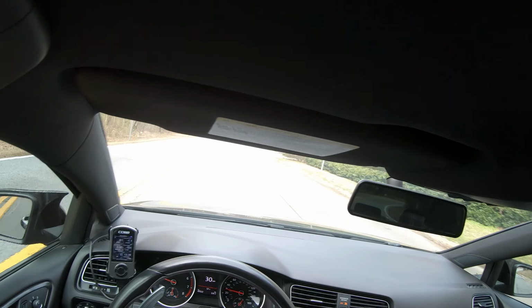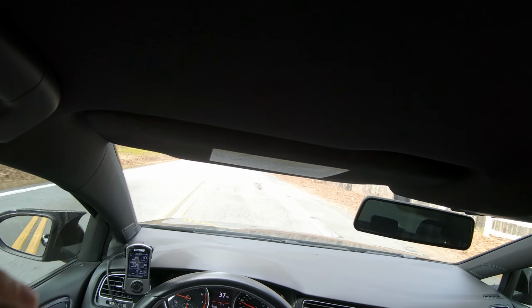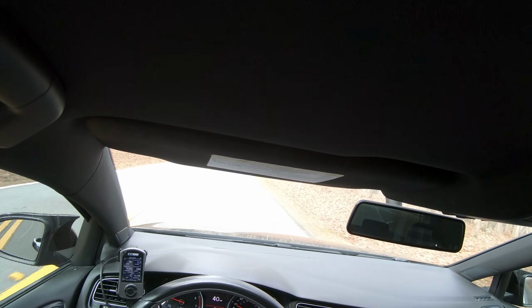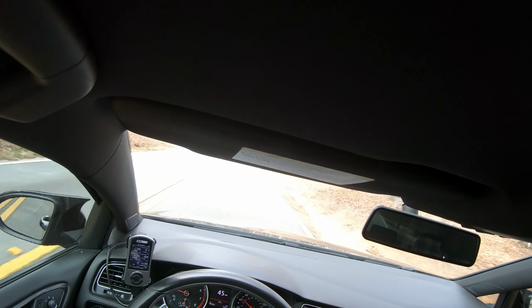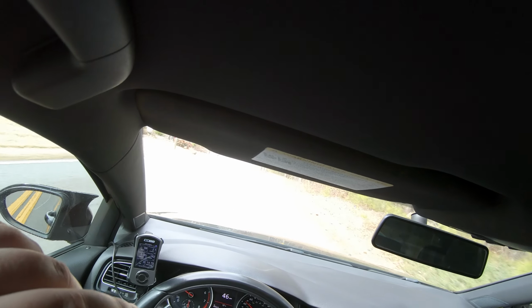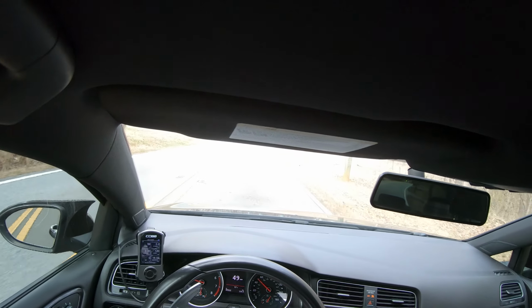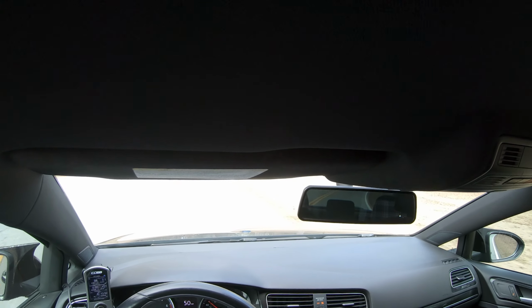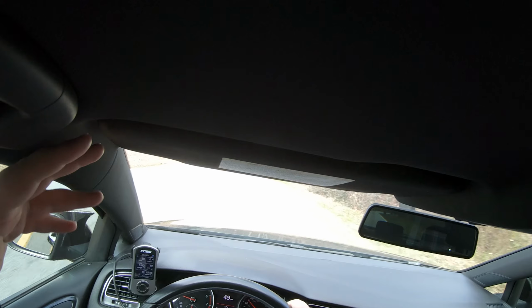Of course, the fuel pump stuff is what I'm actually going to be talking about now. I didn't mean to mention it so early, but the reason I said that this tune is kind of the final revision for this car for now, is my 034 high pressure fuel pump isn't hitting the target for rail pressure at all. Rail pressure target is 3500 PSI. This car is only hitting about 3150-ish, according to Matt. And he actually pulled a data zap from my last log that I didn't do and showed exactly to me what was going on. So I'm probably gonna have to reach out to 034 and be like, hey, something's up with this high pressure pump.